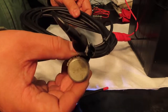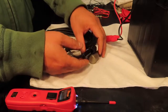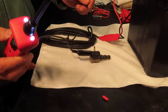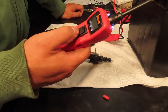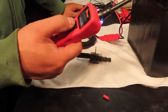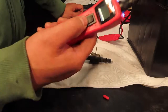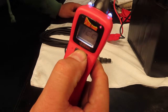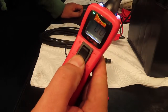As you can see, this is what it looks like. Now I will get this power probe — there's a tip to it. You push up for positive and down for negative. When you push up for positive, it will send 12 volts to the tip. If you push down, it just grounds it. As you can see on the screen, when you push positive it shows 12.2 volts, and when you push down it zeroes out as negative.